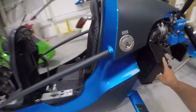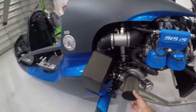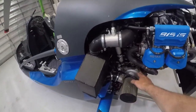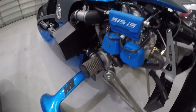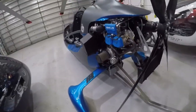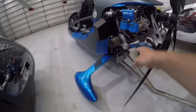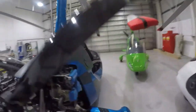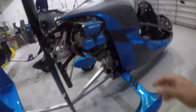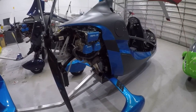The aircraft I flew was a production aircraft — indeed it's the aircraft you're seeing in the film here, which was also previewed a few weeks ago. It was a fixed pitch four-bladed prop, 308 kilos empty weight, with me inside at 80 kilos and 30 litres of fuel on a fairly standard ISA day: 18 degrees centigrade, 1010 millibars of pressure, airfield elevation around 300 feet — so reasonably representative.